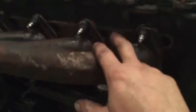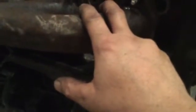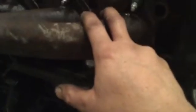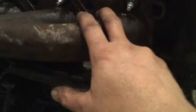So what I have done, I have cleaned off the surface, and I used a copper... God, am I coming to a blank tonight, or what? I'm tired, guys. We've been plowing snow up here like to beat the band. But anyways, I used copper never-seize right across that, which should stop the corrosion that causes those exhaust manifold studs to break.